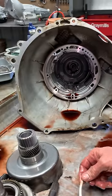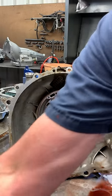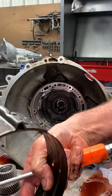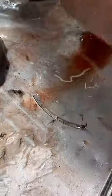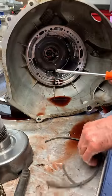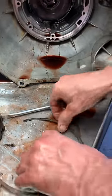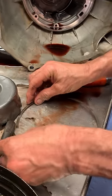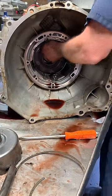This is probably where we started having some issues and where some of this metal came from. We found a broken snap ring down in here — it's all busted out. Looks like it might have eaten some of it. Yeah, there's another piece missing.